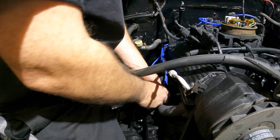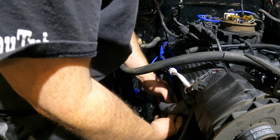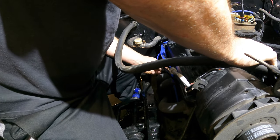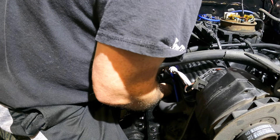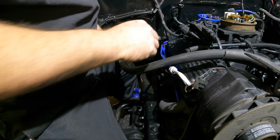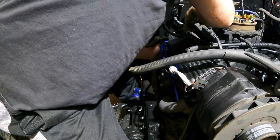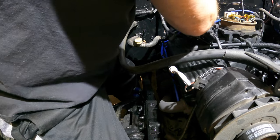I got this new spark plug back in again. I took them out and double-checked the gap on the spark plugs, so they're all good. Plug these back in. One more and we'll be done - this one's a hard one to get to. This is the one that's behind the header. Got her - holy cow, can you believe it? That one's a little long so we're going to have to shorten that one. Might have to readjust these a little bit.